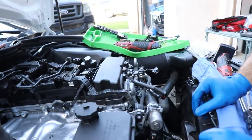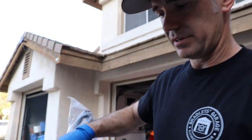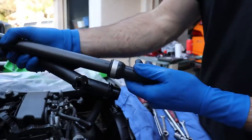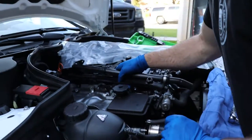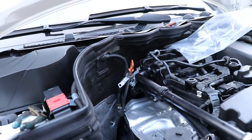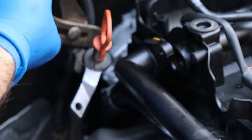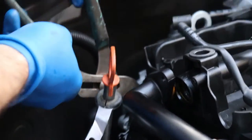Now back on top — let's get our new coolant tube slash air intake tube back on. We have a brand new Mercedes-Benz OEM part. Start in the back and get it hooked up with the hose clamp. Make sure the hose is touching those two tabs, then get the clamp back over the hose. I'm using channel locks since I don't have the special spring-clip pliers — if you guys know what those are, comment below and let us know where to get a set.